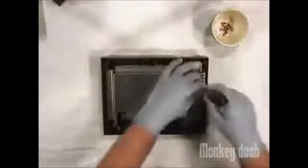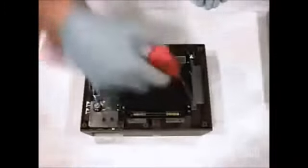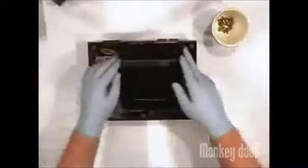Next we must remove the protective plate. Remove the screws. There are also 2 screws mounting the mainboard. Place them in the bowl and remove the plate. This would be a good time to clean out the last 15 or 20 years of dust. Now we must remove the plastic cartridge loader ejector. Place the screws in the bowl and take note of the 2 longer gray screws. They must go back in the same place.